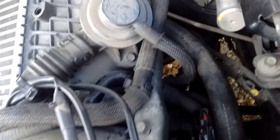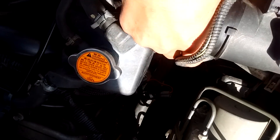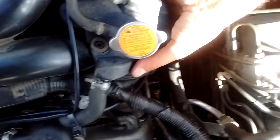That other yellow one right down there. And then you'll come over here to the other side — this one's a little bit trickier. I've already loosened this stuff up so we can get in here quick. Pull the bolt on this, pull it out of the way, put my bolt in a safe spot, and just pop this up out of the way. You can see the other fuel injector port is right there.